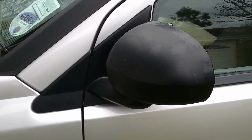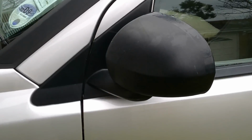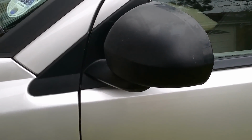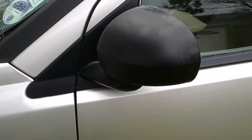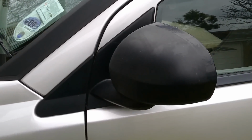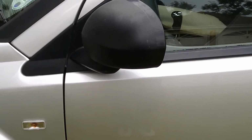Now in the States, people get it all mixed up because they're saying it's on the left side or the right side. It's whatever side the bonnet release or the hood release is on. But that triangular bit is where the water's getting in. But like I say, you must puncture that bit of foam. It's a foamy, spongy type material that goes by the bonnet release catch. I can't emphasise enough how important that is.